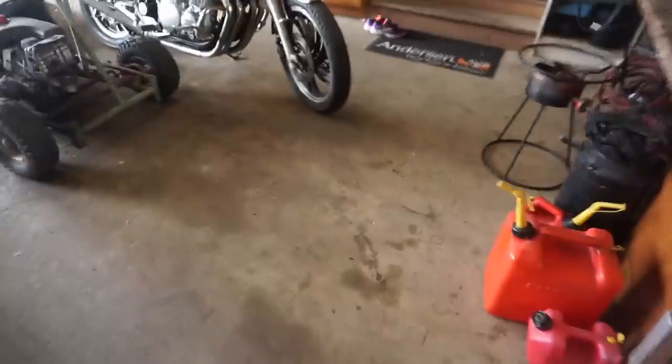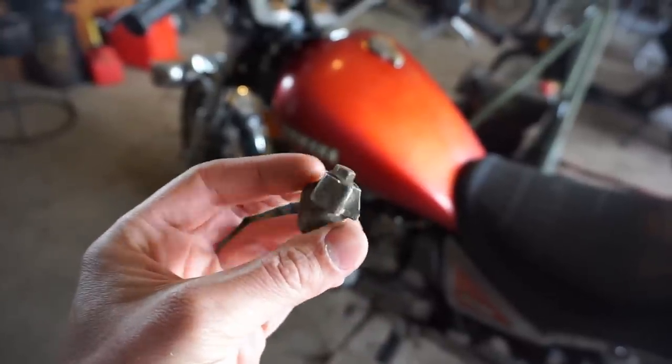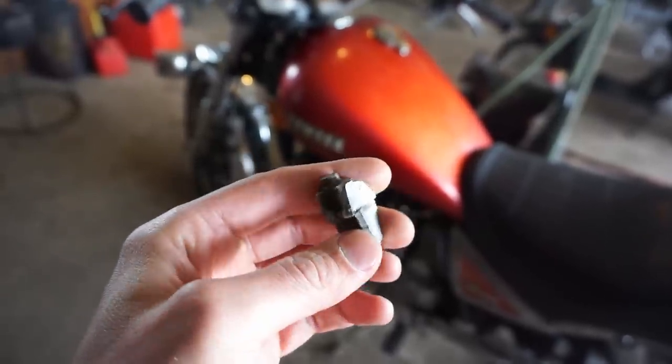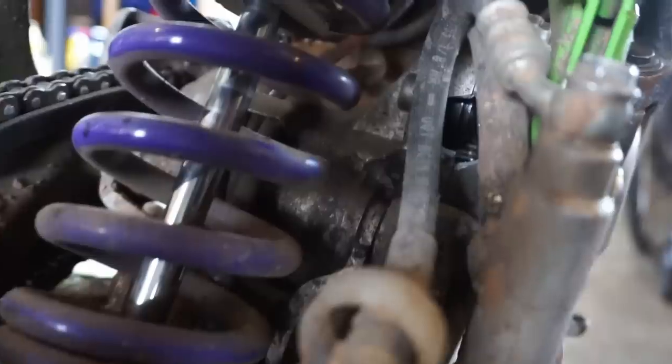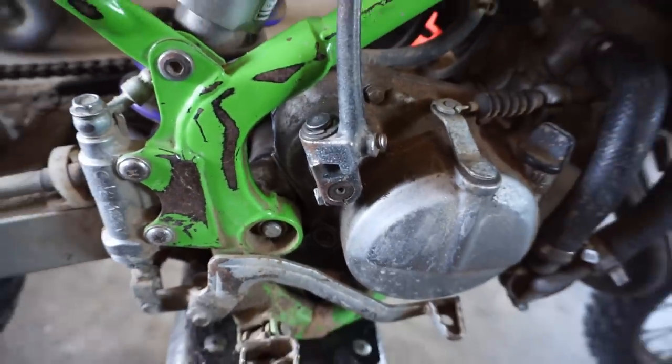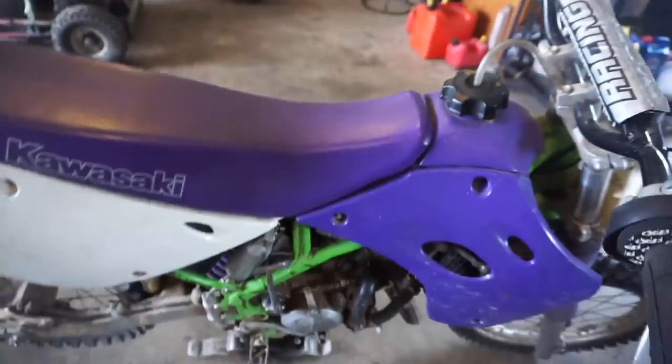I've got the piece that broke off right over here. Let's see here. This is the piece for it. It's a pretty big chunk. So one part meshes with the clutch cover, the whole clutch cover case, and then one meshes with the whole engine case. So it's like right down the middle. So basically what you need to do is weld this piece back in there, right in that spot right there. Let me zoom up. See that big crack spot where you can see through it? This piece needs to just go right back in there. So that should be an exciting task. I might have to take out the whole engine to do it just so we can weld it, but I guess we'll see when we get that far. So stay tuned, should be pretty exciting.